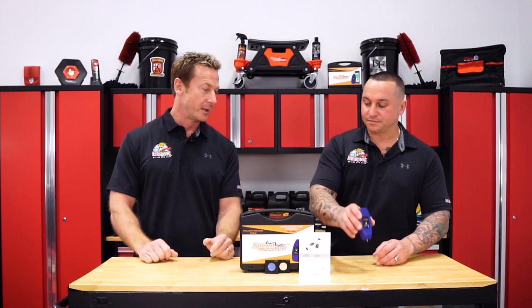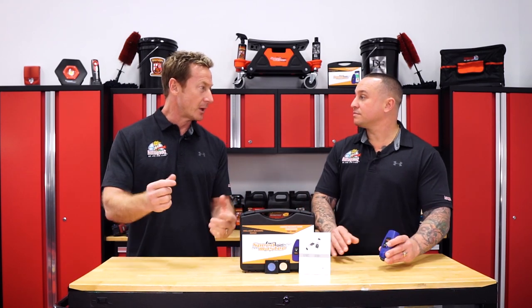So insurance meaning — someone brings you the car as a professional detailer, wants you to do a certain amount of work, and you can look at this and say, 'You've only got two mils of coating — I can't dig that deep or I'm going to go through it.' Correct. If a customer calls and says they need something sanded or compounded, that's a very aggressive approach to leveling the clear coat. So prior to that service I'll measure the panel, that way I know I can go into it safely. If I don't, I'm going to screw myself, the customer's going to be upset, and I'll have to send it to the body shop.